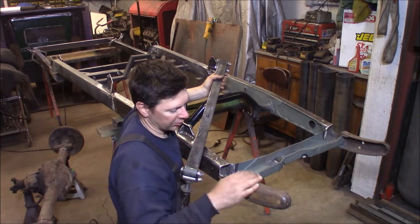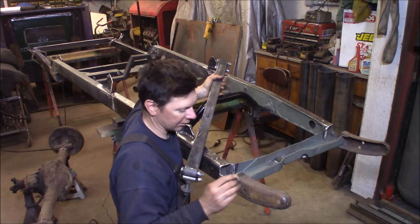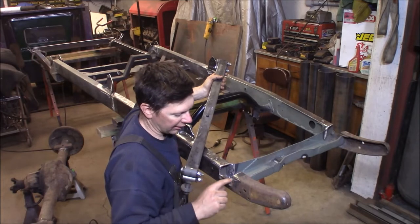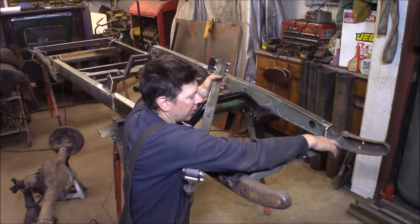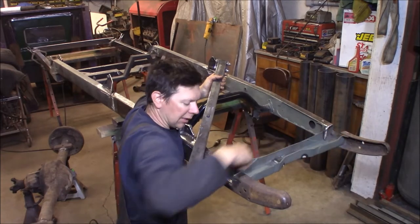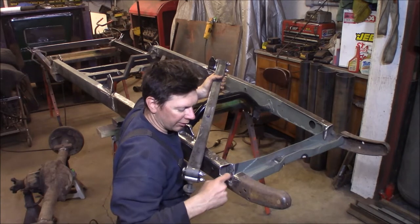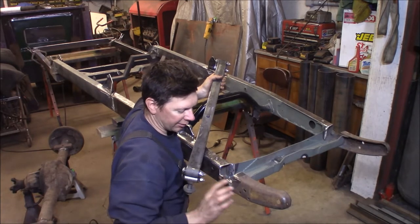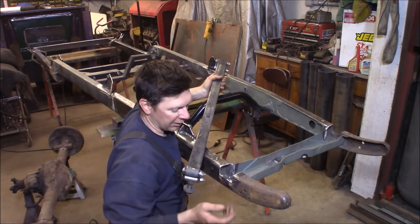With a 2-inch drop spring, things are getting kind of tight. So I've gone ahead and notched the frame down to the inner part of the original crossmember, which I've grafted onto, and it's all riveted together still the way Ford did it. It's about a quarter inch thick all the way around where the brackets are, so it's going to be plenty strong enough to hold the front suspension.